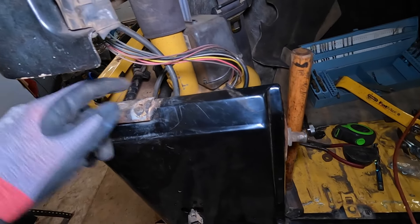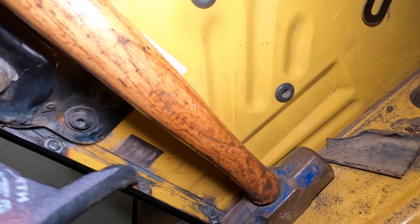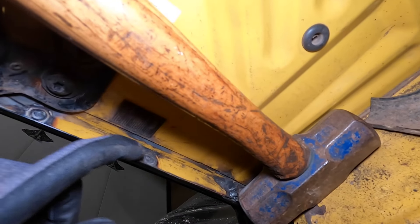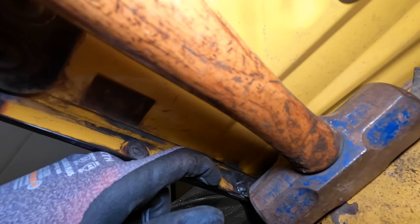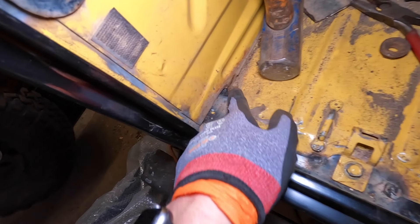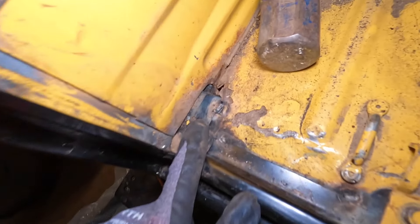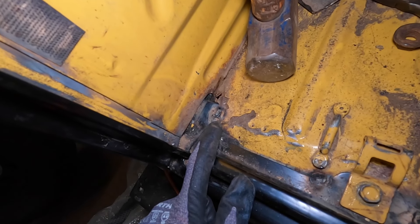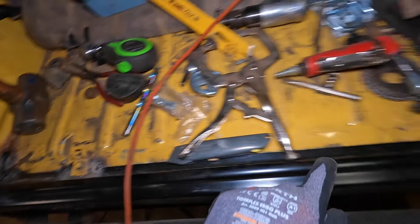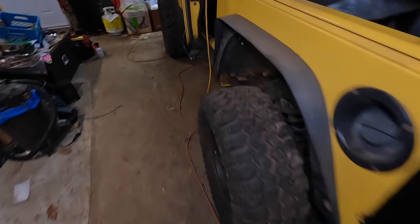There's also a weld on the top, a couple plug welds there, and also a couple plug welds in here. I'm going to throw on a layer of seam sealer just after that little ledge to cover that up and make sure no moisture gets in between the panels. We're going to throw some seam sealer down here too — I think it'll cover up that little hole, because that's how it was from factory. The seam sealer covered up most of the junk we were trying to cover. We're going to run a layer all along here and Todd's going to weld this side today.